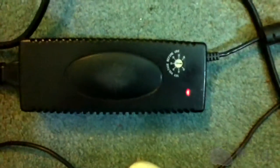All right, enough of my yakking. Let's go ahead and power this thing up. The power supply is on, which only leaves one thing. That is to turn the laptop on. I'm also going to plug in the Ethernet cable, because I do want to be able to go online with this. I'm going to use both Ethernet cards in this video. However, I'm going to use the Realtek with Linux, because it's the only one that works with Linux. The 3Com does not, because of an I/O hardware conflict, as far as I can tell. I might have to resolve that, maybe by plugging it into a different slot. I'm not quite sure, but I'll use the Realtek for that, because we're going to start Linux first. We'll turn it on. It appears as though it is actually plugged in, and receiving power, which is good.